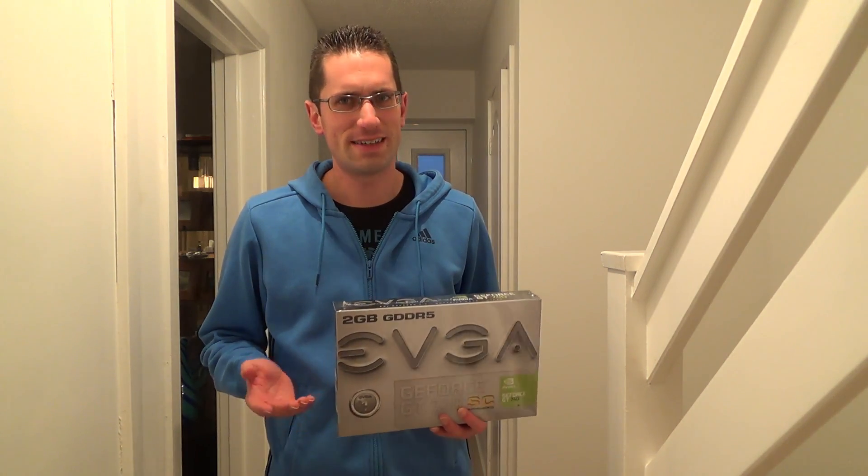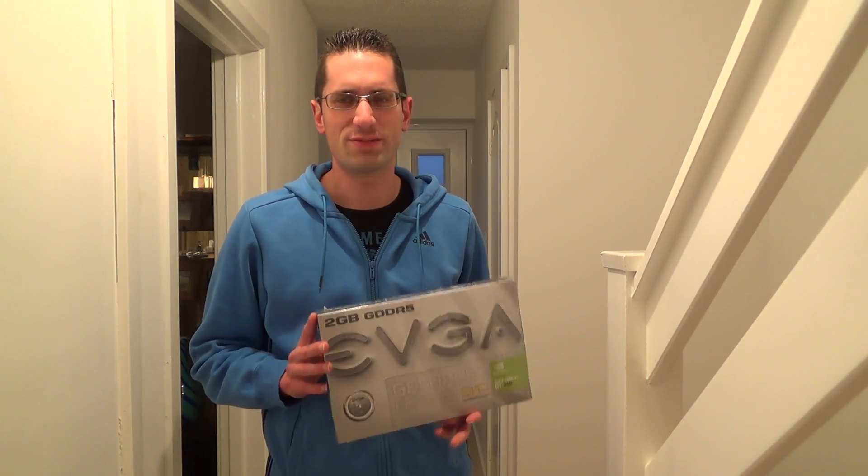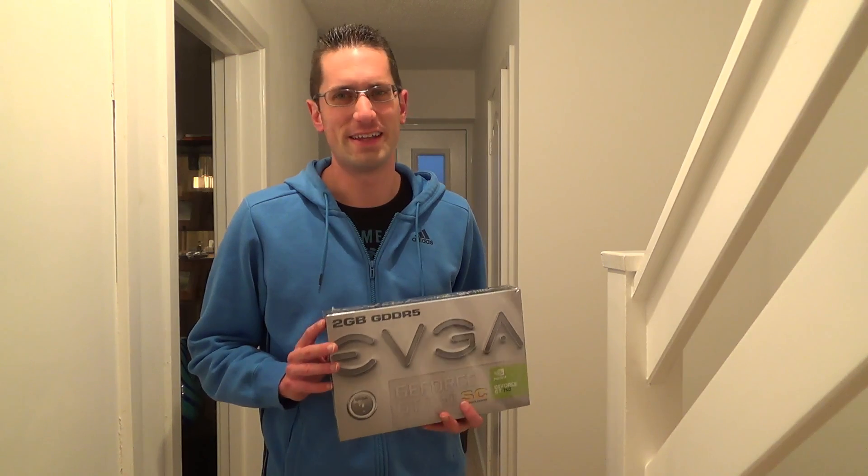This is to replace my NVIDIA GT 640 graphics card in my home theater PC. Now there's not a huge performance boost there, but it's going to be slightly quieter because this one has a larger fan on it. This was the main reason I bought it, and I didn't really want to go up any higher in the range because the motherboard only has a 4x PCIe slot. Now most graphics cards normally require a 16x slot, but they will work in the smaller slot, though you're throttling them if you do so.